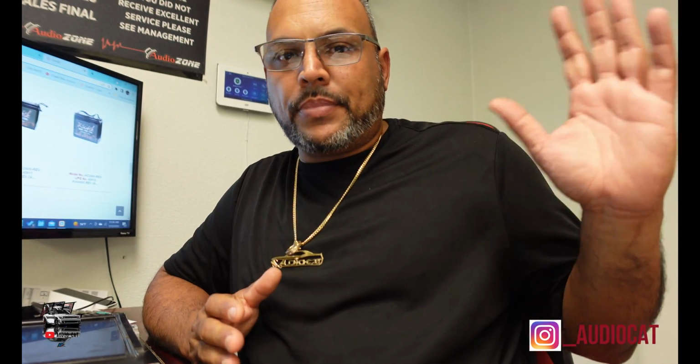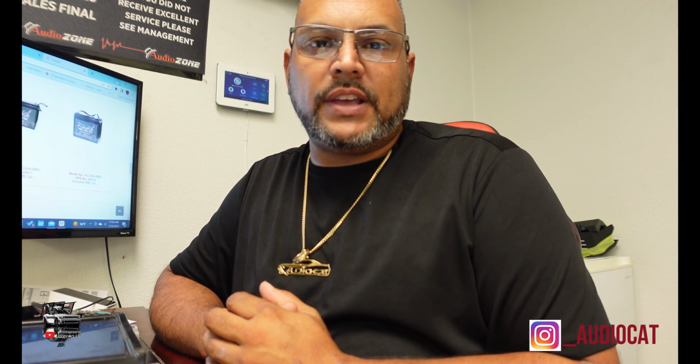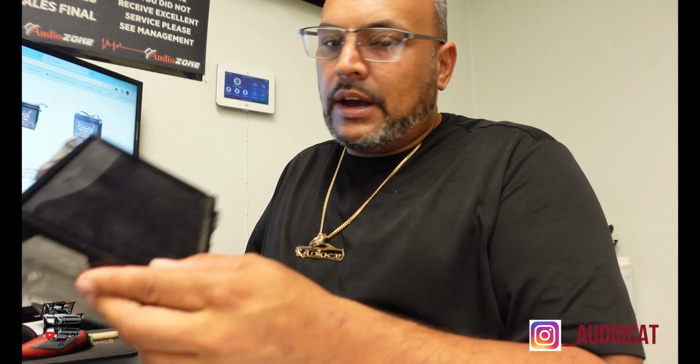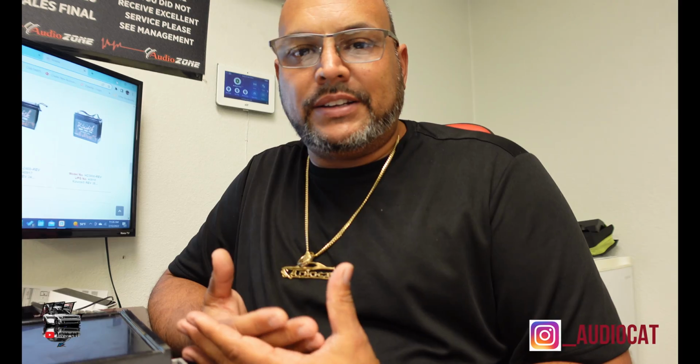Alright, Cruise Crew, so I'm gonna bring this video to you guys. It's on a Dodge Charger, Challenger, most of the 8.4 Uconnects from the Dodge platform. As y'all could tell, this one I have here, you guys see this very famous glare thing. This is actually something that happens a lot to these Dodge radios, and it's pretty simple to fix. It's only really a digitizer.